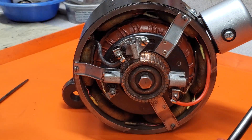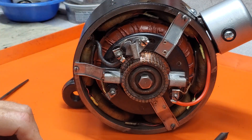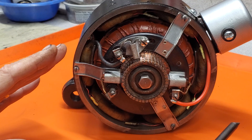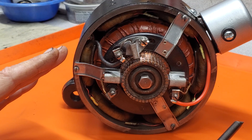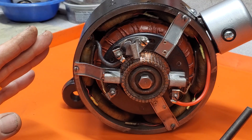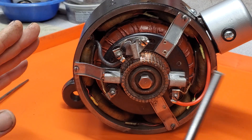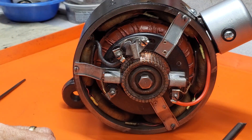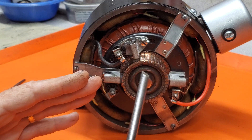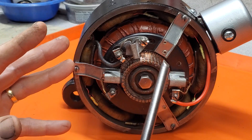For most people doing normal daytime driving, you want this set at its lowest output. Because even at its lowest setting these generators put out a lot of amperage — somewhere in the neighborhood of 10 amps at 2000 generator RPM. And that's a lot of current; that's really slamming the battery. You only need about four or five amps to normally just keep the battery charged for normal daytime driving. So they do benefit a lot from an electronic voltage regulator — the EVR is available and that is a nice upgrade to control the output.